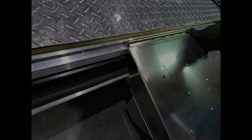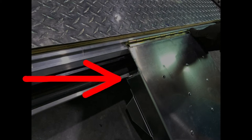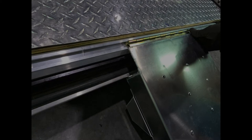All trailers are different — this is a Continental Cargo Automaster. I quickly found there are two significant issues to getting these ramps installed on the trailer. First, by the time you get the track high enough on the door to clear the opening, your ramp is hitting the end of your door. This condition is caused by this area of the ramp, which is only two and a half inches wide, when it really needs to be at least four inches wide.